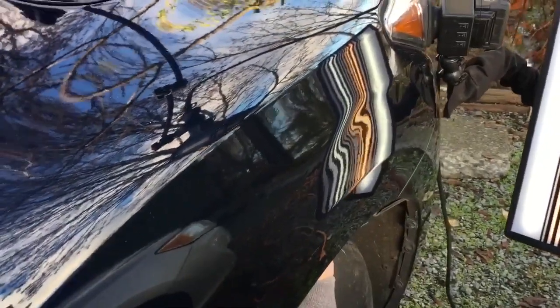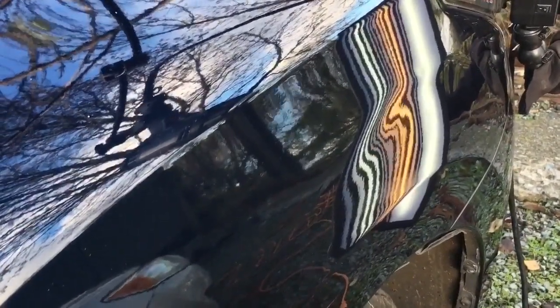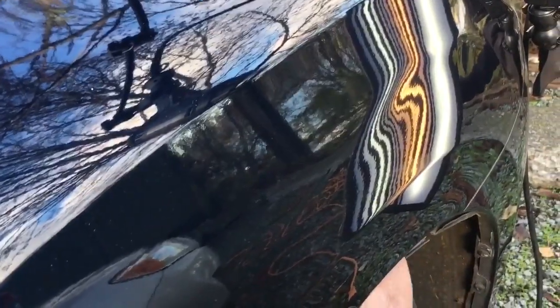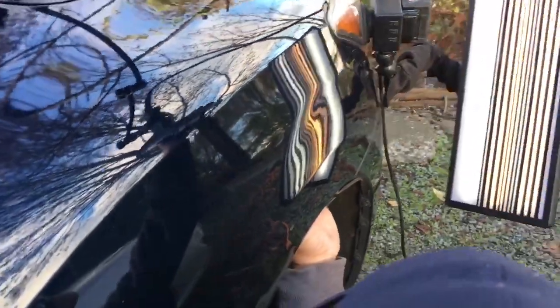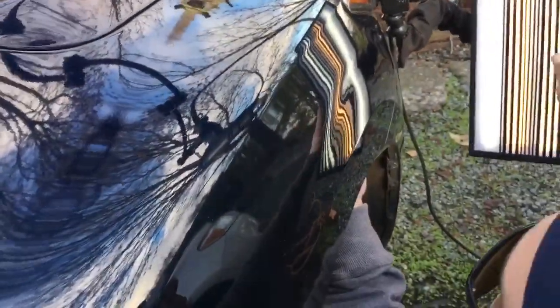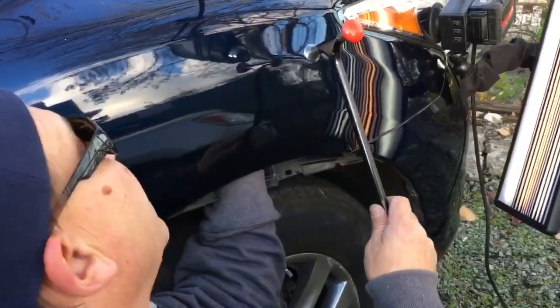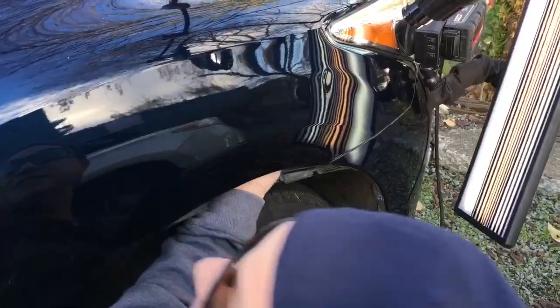I think what we might do is get a little super speedy going for you guys. Let me make this first initial push just to kind of clean up the back side of this one — I'm just looking through the fog — getting some of that out real quick, and that's as far as I can go with it. That's why we've got it nice and heated up guys, because it's gonna allow that metal to move without fracturing the paint, without making any weird push marks — just a little bit more malleable. I'd say this metal's up to about a hundred now. I've got the heat gun fairly far away and turned down, so it's not at its hottest setting. I'm just gonna start tooling away, do a little bit more tapping, a little bit more tooling, and I'll keep you guys in on speedy. We'll come back and show you the end result in just a bit.